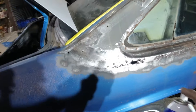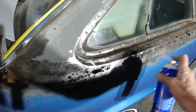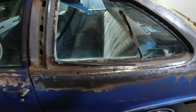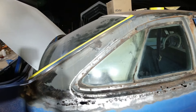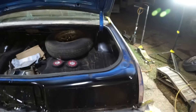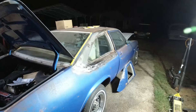I got all this ground down. I'm just going to use some rust neutralizer over this rust, and I got the other side too. Let me coat that and probably come back tomorrow morning and put some Dyna glass fiber glass filler over all them holes. I'm not going to bother cutting it out and welding in stuff — like I said, this is a cheap car, it ain't worth a big restoration job. This stuff's taking a while to dry, it's still tacky and getting all dust in it from doing all this. We'll see you tomorrow.